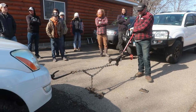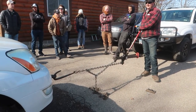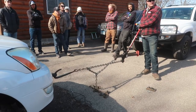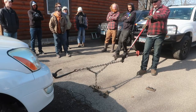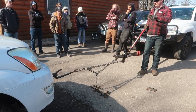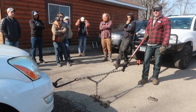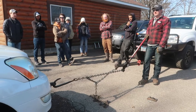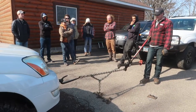Sometimes you gotta get off and do a little bit of work to get down the trail. But you can also high lift yourself out of a rut. Or high lift yourself up and put rocks or sticks or whatever underneath there. If you get high center or you lose traction or you get into a hole or something, you can use it to lift yourself up. But you gotta be careful when you're lifting up these things.